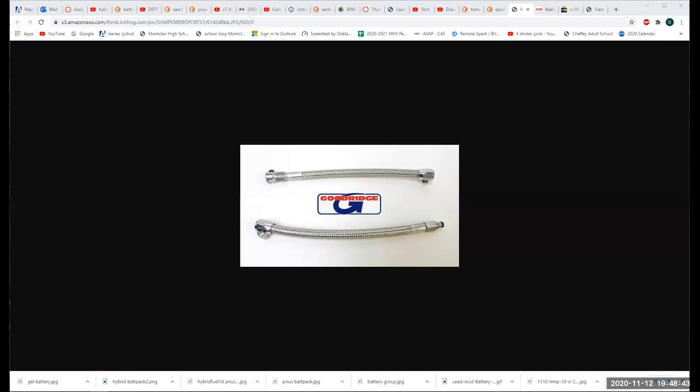But yeah, we use dyes in, for instance, air conditioning diagnosis. So if we have some kind of leak, which is extraordinarily common, we can pick it up with, say, an ultraviolet black light, depending on the leak detection system you have. But that's kind of specialized. I'm just saying the dye makes it easier to see. So if it's a slow leak or a slight leak, you're not going to be so powerless to identify it and its source.